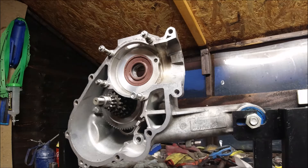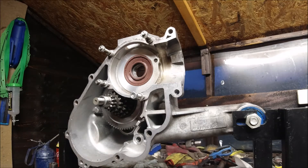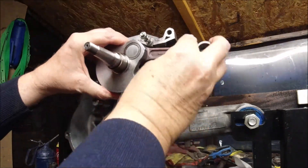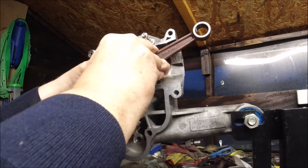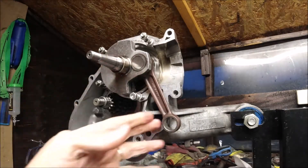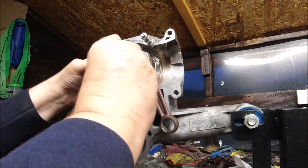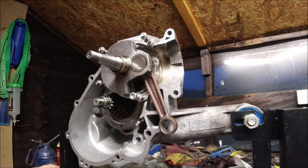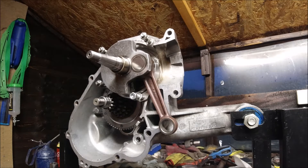We've got two-stroke oil on our main bearing - the big bearing is oiled and the windows are clear. I'm happy with that so what I'm going to do is just start that off in the engine, push it home slightly with your hands. We need to make sure that the conrod doesn't get caught when we're pulling it through. I'll cut away, get the tools together and the bits and bobs that I use.